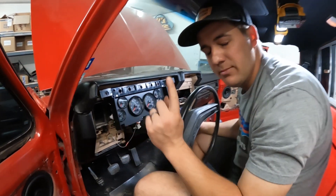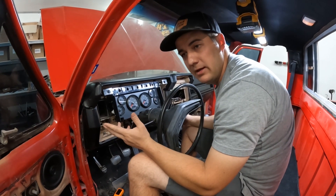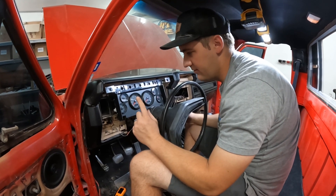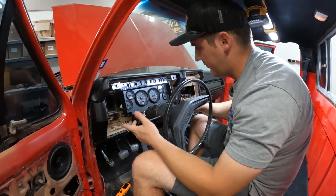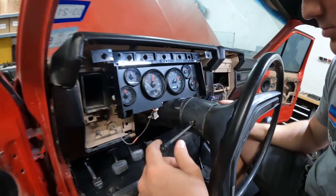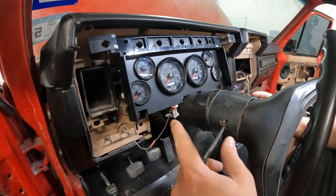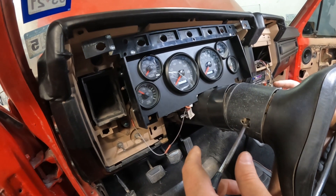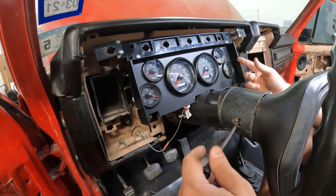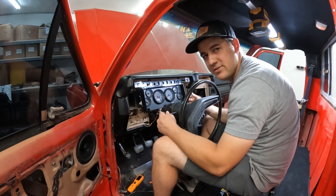Round two — I think I've got a lot of stuff fixed. We're still missing speedometer and tachometer and I still have to program them. For the speedo, we're going to wire in a GPS speedometer, and for tach we're going to run it off the alternator. But everything else should be in — water temp, oil pressure, everything. Our gauges work, they sweep. The fuel should read correctly once calibrated, and with the oil pressure sensor plugged in I'm at least getting a reading, which is good.